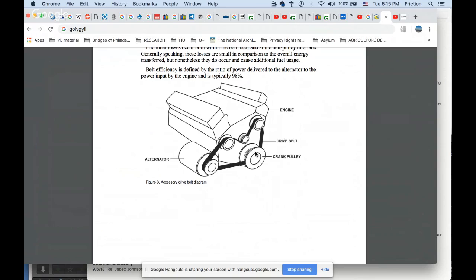And then it gets to a pulley. Ultimately, you get to a pulley. This is that belt that it's on there. With that said, if you undo this belt, you've got an engine that works perfectly, no problem at all, except usually they put a fan here too that helps cool down the engine. So that could be an issue for you, depending on where you live and the temperature, whether the fan belt would be that important at that point. But your car would then run.